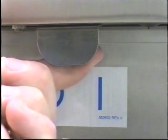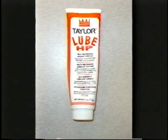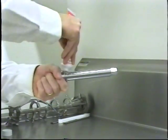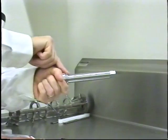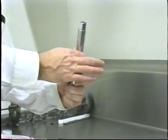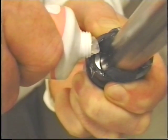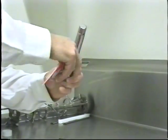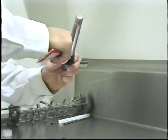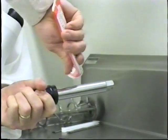Make sure the power switch is off. When lubricating parts, use an approved food grade lubricant such as Taylor Lube. Before installing the beater drive shaft, lubricate the groove on the beater drive shaft. The middle section of the boot seal should be convex or extended out. If not, turn the seal inside out. Slide the boot seal over the small end of the shaft and engage into the groove on the shaft. Heavily lubricate the inside portion of the boot seal and also lubricate the flat end that comes in contact with the rear shell bearing. Apply an even coat of lubricant to the shaft. Do not lubricate the hex end.